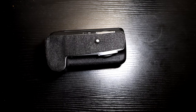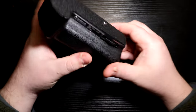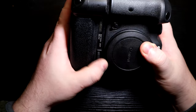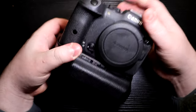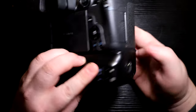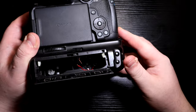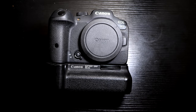The final step here is I've got some really cheap eBay felt with a sticky backing, just cut to the shape of the top of the grip, so there's a little bit of friction on the bottom of the R7 but it won't damage it. When we actually do the grip up, it nicely compresses and everything is nice and flush now. And then we are literally looking at a battery grip on the R7. Obviously it's not fully functional at this stage, but you still have everything on there. You've got a working battery compartment and the cables are already routed through ready for the next part — getting the shutter button working with the camera.